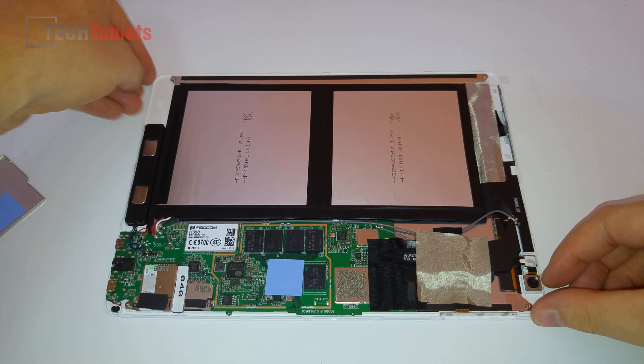Here's the end result. Really good thermals — just crazy. 41 degrees is the max. I've been running the CPU-Z stress test here and that's been going for 15 minutes. You can see there the timer — 15 minutes — and along here you can see that it's 100% max, just been running at 100% the whole time. At the moment it's running some of the cores at 38 degrees, and the core max is 41.